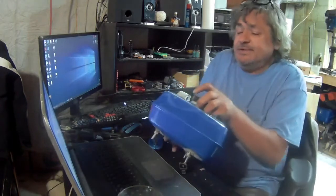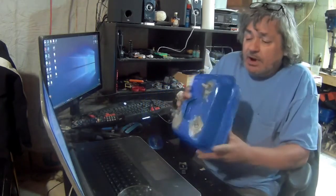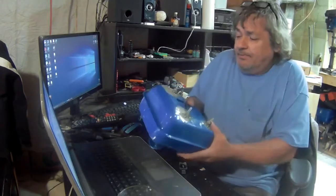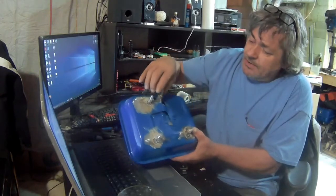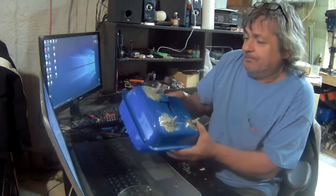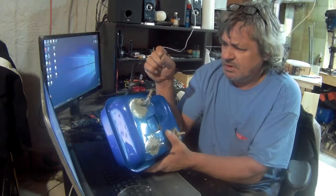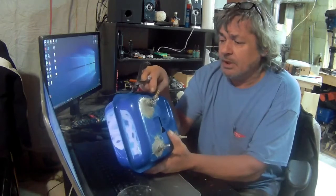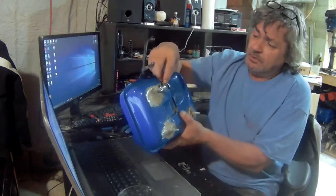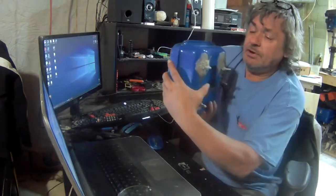So I'm not gonna go that route. What I'm gonna do is use this gas tank off of the motor I'm gonna use on this bike. I already welded the mounts on the bike itself and then welded the bolts on the tank. I also welded a fitting over here because the outlet coming out of here was about an eighth of an inch, and the tubing cracked and broke on me. So I welded this fitting on here for the gas.